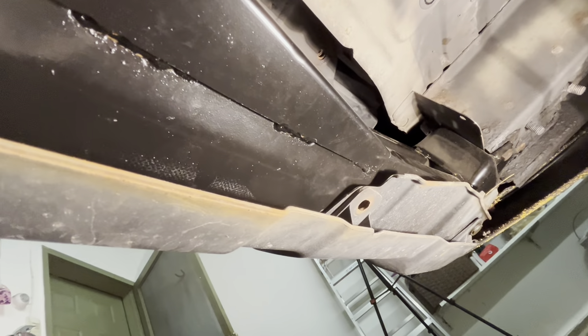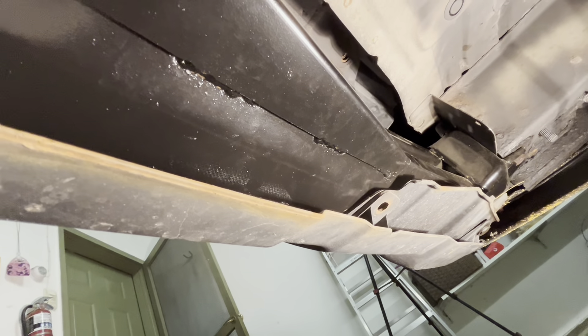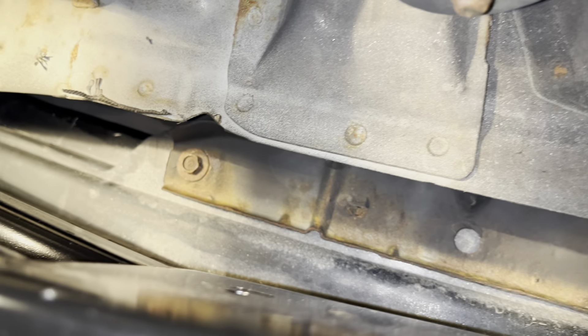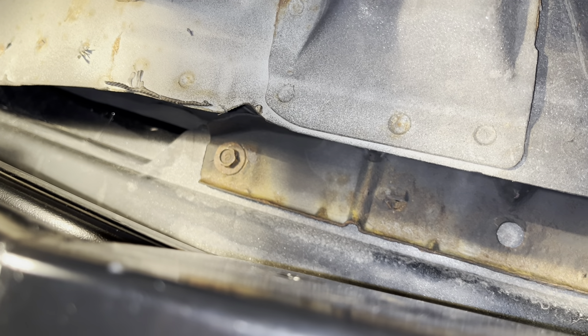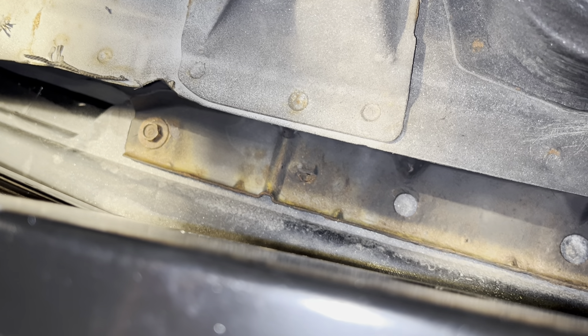I have two clips, but in my case I'm actually missing two. So I put the two I had in the middle and I'll stop at the hardware store and pick up two more to get that secured. I have my three 10mm bolts reinstalled underneath the bumper. The only thing left now is to replace the four screws on each side in the wheel well.